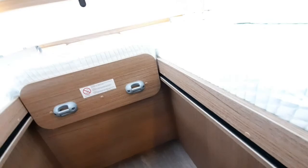So twist it and push it. If it's ever popped out, then it's just going to drain down. In essence, as soon as you're running your pump, your pump is going out your cold water tank into this boiler, but that boiler then is draining out onto the floor outside the vehicle. So always get into the habit of making sure that's closed, because it becomes quite frustrating wasting all that water that would have been underneath it.